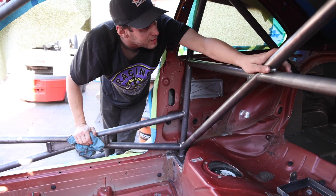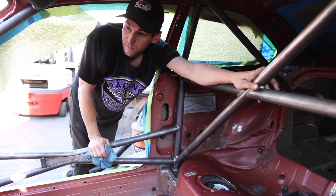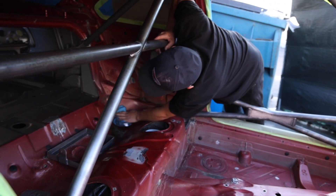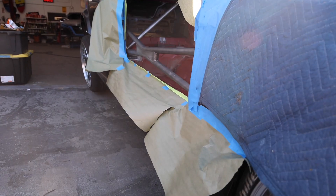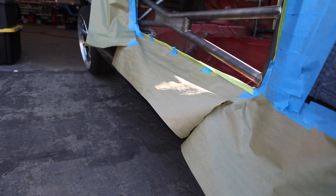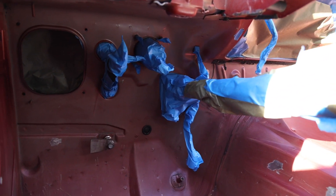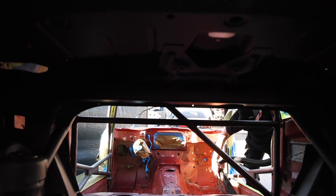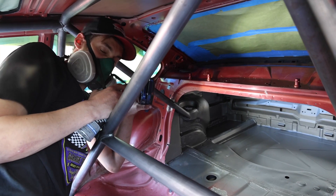We are dang close. We've got pretty much the whole outside of the car taped off, or we've got a blanket laid over it, so we're going to try and minimize the overspray as best as we can. I'm just giving it a final wipe down with some cleaner. We pretty much scotch-brited everything and taped off the back window. Every time I do this, it just blows me away how much work it actually is, but the finished product is worth it for sure. The quality of the paint is in the prep work, so we're spending a bunch of time getting it all prepped up. I just can't wait for this thing to be all nice and clean and gray. I'm going to start from the back, paint everything back there first, and then just work our way forward.